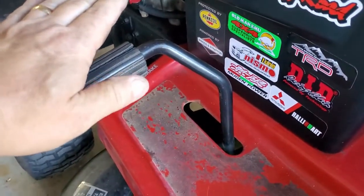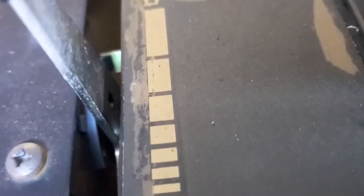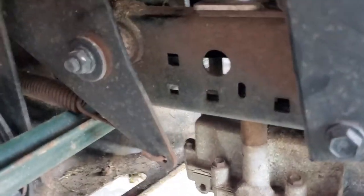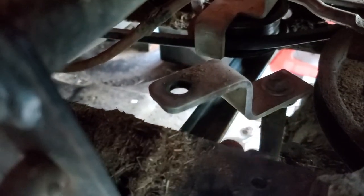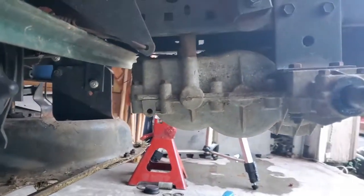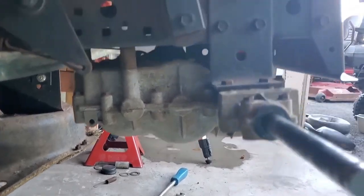To set the emergency brake on this model, you push this down and engage the lever, then slowly pull up and it locks all the way down. When you do that, this goes to clutch-neutral and that belt is loose. So that should give me enough leeway to get this thing dropped out. I'm going to pull the bolts out, stick the jack under the case — it's not that heavy — then lower it down slowly and get it around that pulley.